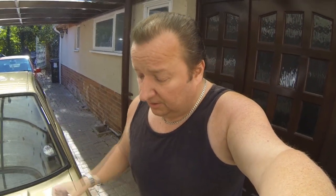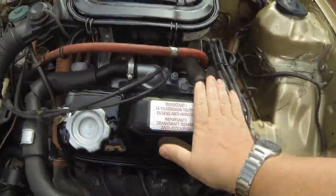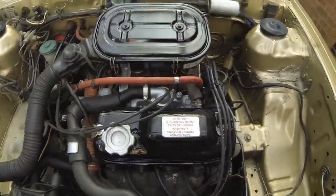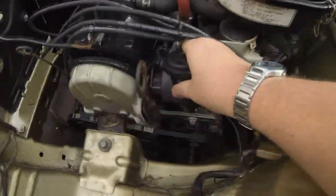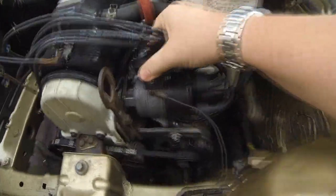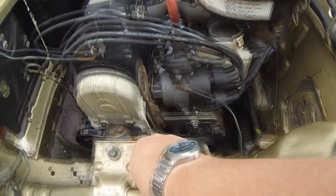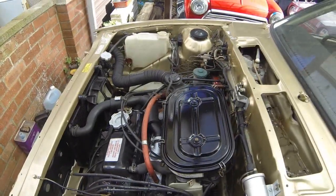I want to get the stuff circulating around the engine - the white vinegar that's inside to clear all the waterways out. As you can see, I've just put that original label back on the front there just to keep its originality. I've left the distributor loose so I'm going to put the battery on - it's got a full charge. I may need to just gradually turn it to get it started, and once it starts I've got the timing marks down there to do the timing with. I've got a strobe light, so I'm just going to put the battery on now.